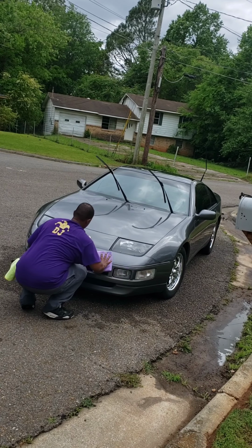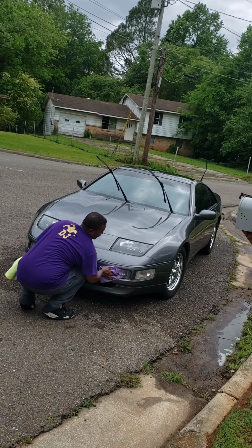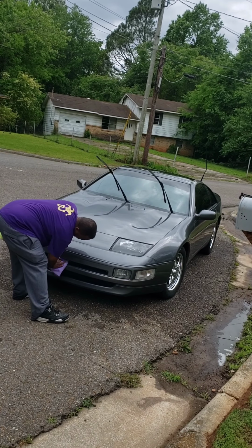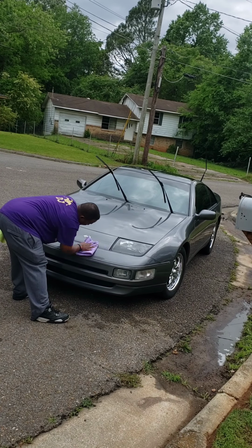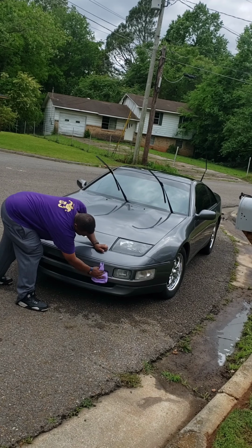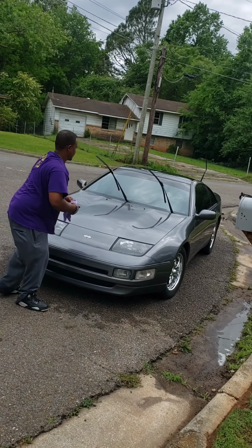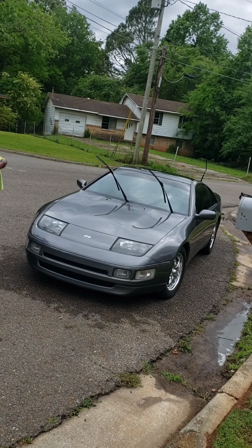Not only is it a good standalone product, it's also really great as a ceramic coating topper. And it doesn't really depend on the brand of ceramic coating you use. This can go on top of any of them. So you might ask, what is the need for a top coat? Well, if there is any real downside to a ceramic coating, it's that they are pretty prone to water spots, which are not really hard to remove, but who wants to see them in the first place? So the companies came up with formulations for their brand to go on top of the coating to help out the properties that are lacking in the coating to resist the water spots.